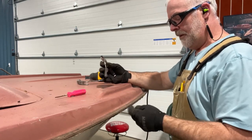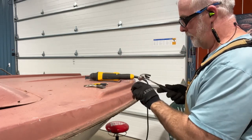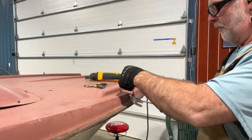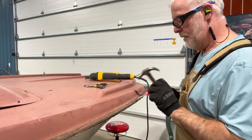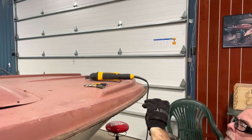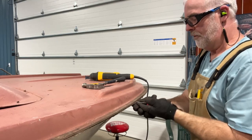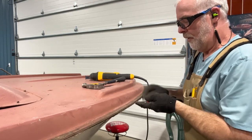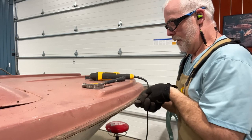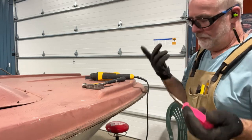So there's that way of doing it. You could also just go in and use the screwdriver and hammer technique. Straightened out. Sometimes using the flat of your screwdriver, get back up under the deck, put it in from the bottom, and pull up so you're not damaging the gel coat. If there's anything going on, it's going to be here at the rub rail. But I find it very difficult. It really doesn't want to come out. So, here it goes, yeah. But the staple broke.